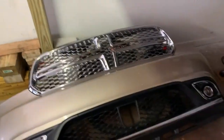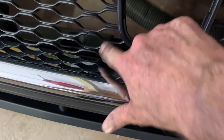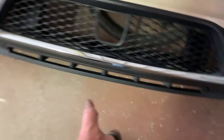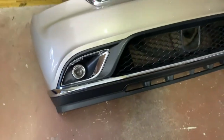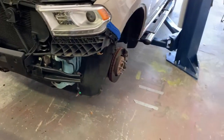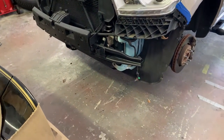The piece comes off to the side. Something I'm going to have to address is that when the debris hit us it broke one of these plastic retainer pieces — you can see the big mark there. I'll need to get a new piece for that, and it also popped some clips out, so I have to get all that back in place. The car is at ground level now; I'll raise it back up and start working on the sensor.